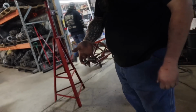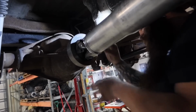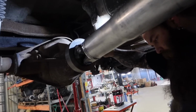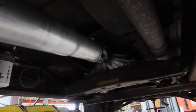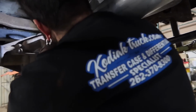So you can reuse your old bolts then? Yep. Guys, technically, if somebody didn't want to get the adapter, you would have to take that U-joint out. And do they even make a 1410/1480 U-joint? I haven't seen one, but I haven't researched it either. So it's pretty much just smarter to get all the pieces at the same time. Right. So go ahead and get the drive shaft, both the new 1480 straps, as well as the new yoke end for it.